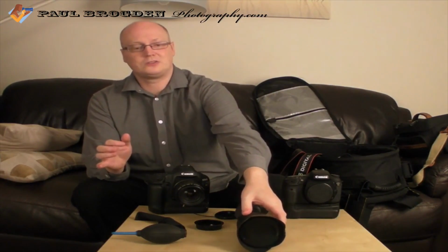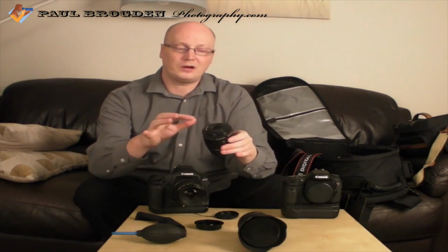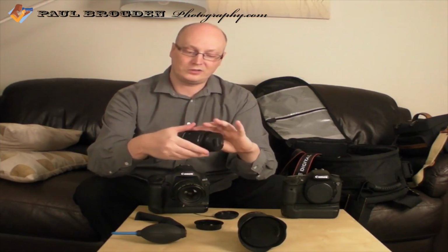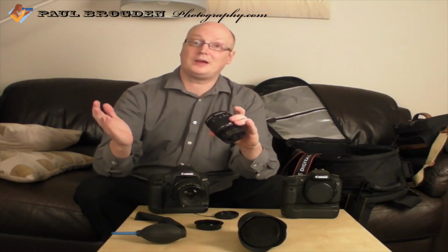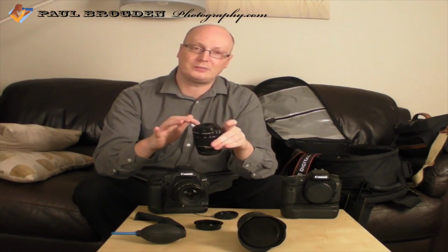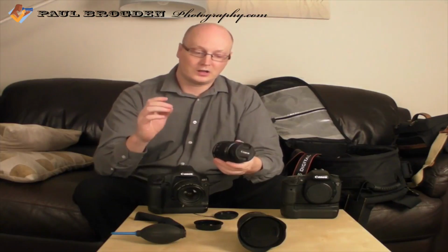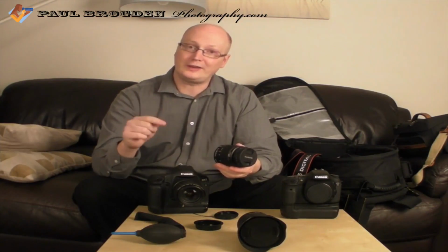However, with the Canon ones it's a bit different, because they put a plastic raised hub ring around, which means if you were able to take any pictures with your shutter, it's likely that the mirror would hit that raised bit of plastic. Also, when you try and put that in, it's likely that you'll dislodge the focus screen.